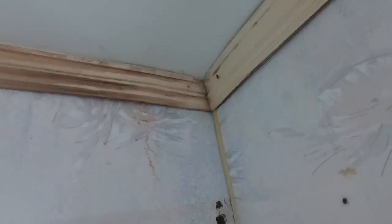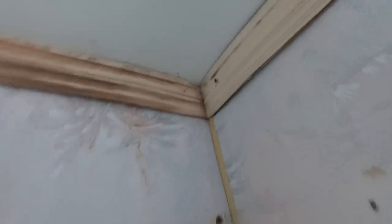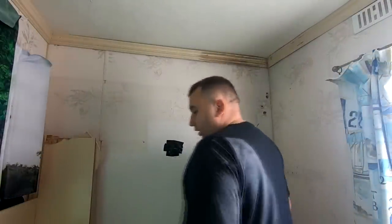But yeah, that is ringing wet there. I don't know if you can see — the wood is actually rolling up with my finger. That side seems dry, which is good. So it's something to do with this. We're going to rip this coving down here — that's no good now, it's all bowed — so it's going to have to come down. I'm going to get the old pry bar out, we'll pry that off and have a look behind that.